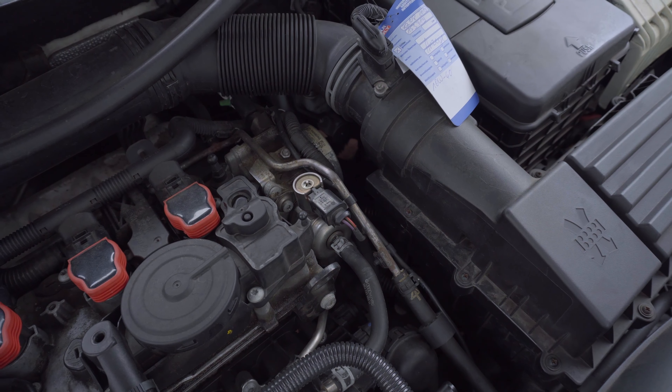Now I'll show you the MK7. This is the MK7 GTI with the CHHA engine. In the S3, Club Sport, or the R you have the CJX, which is very similar. I'm very glad they solved the chain issue. Also, most importantly, they solved the carbon deposit problem in the intake manifold, and the injectors don't get as much dirt as on the former model.